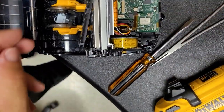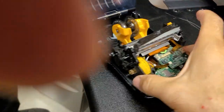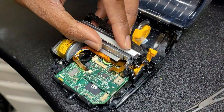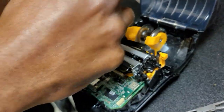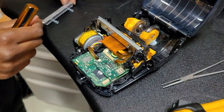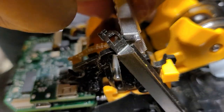Once that's out of the way, it does have a ribbon cable attached to it, so it can be pushed out of the way a little bit. On either side of the pressure bar there are two tabs — pry the plastic apart and it has spring pressure behind it, pushing away from the printhead itself. That can be moved out of the way. The printhead has tabs on either side and has to rotate and come up — you'll see the directional tabs.